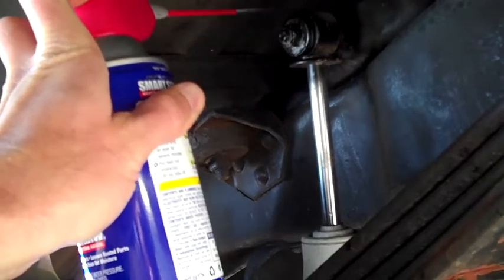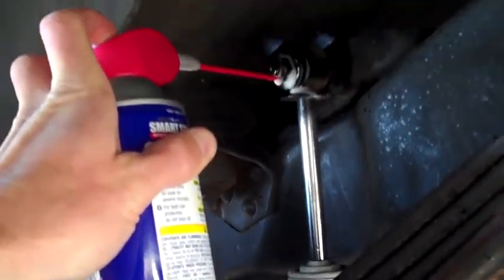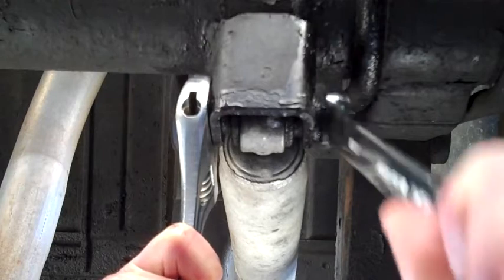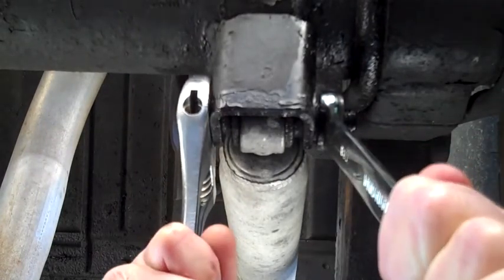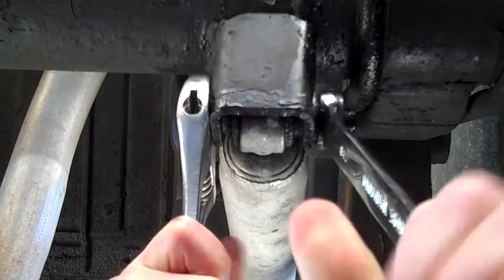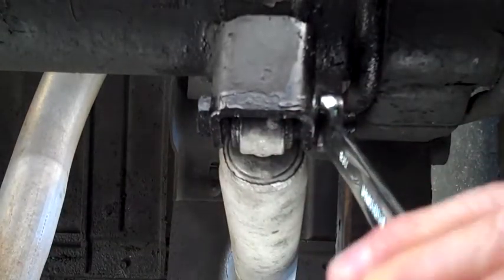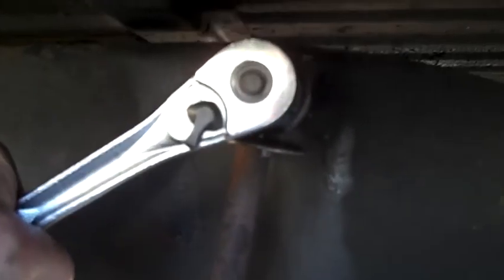To get the old shocks off, make sure you spray the upper and lower bolts ahead of time with WD-40 or anti-seize of your choice — I'm not sponsored by WD-40. Let it sit for a while, especially if they've been on since the early 90s or late 80s like mine. It's going to be pretty tough. I struggled and had to use two hands, and I also bumped my head. Take the bottom ones off first, then take the top ones off. There's a little washer up there and they should just pull right off.